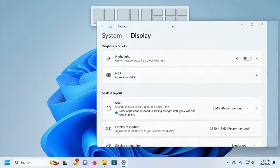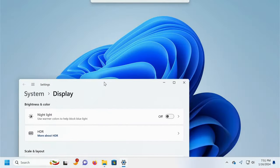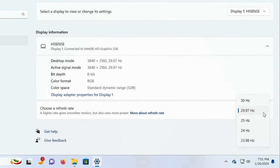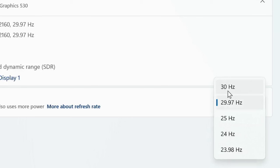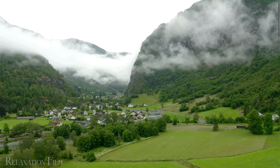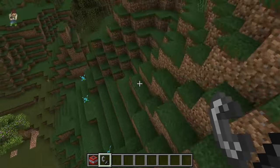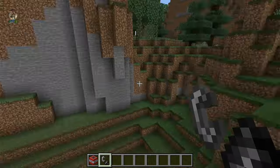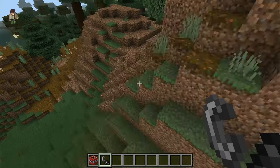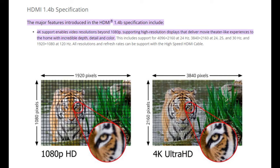When I first started using the mini PC with my TV, I noticed that the input seemed kind of laggy. I soon realized that the maximum output frequency was 30 Hz. Watching a 4K video would often result in long pauses. Minecraft was not very playable with a lot of input lag and choppy video. I realized the problem was that I had the TV plugged into the HDMI port, which was HDMI 1.4 — which has a maximum of 30 Hz output at 4K resolution.